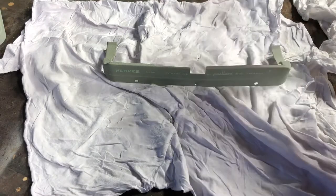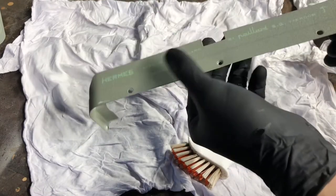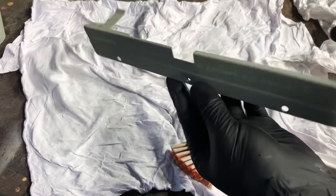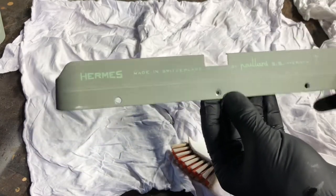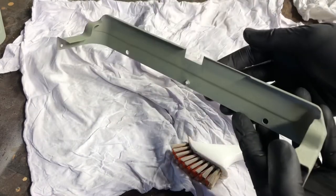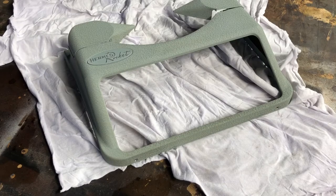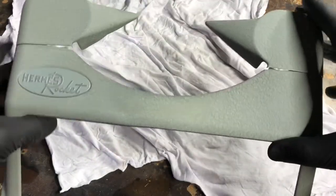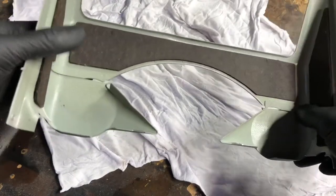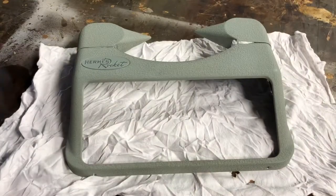Quick side note: be as careful as possible. I use a very gentle brush and a very gentle cleaning solution — it takes a gentle hand not to bend this really thin metal. I'm surprised how relatively clean this typewriter is, because the case was disgusting. I'm only cleaning the exterior of the steel body panels, not the interior. Once clean, I dried the panels off with a rag, then flipped them over and dried any excess moisture on the inside to prevent future rust.